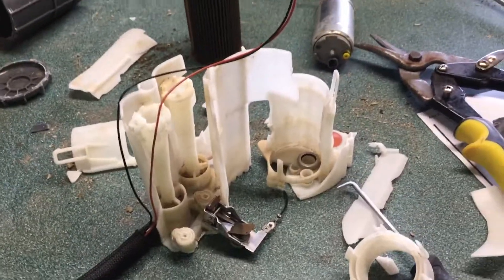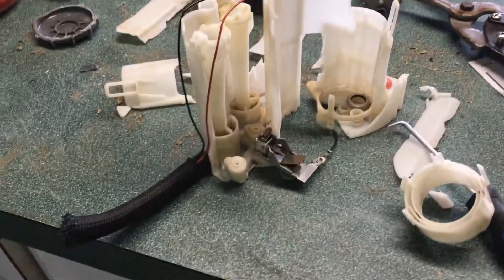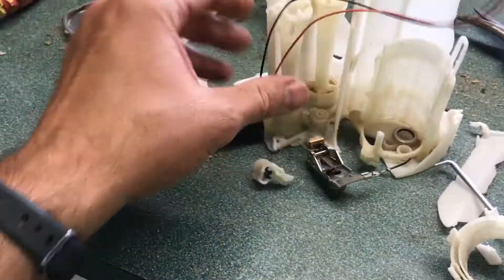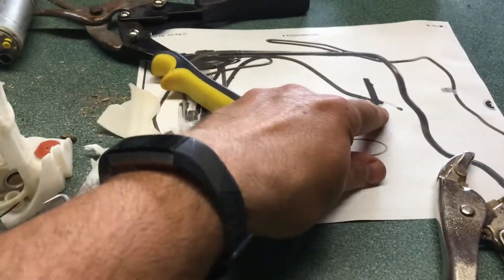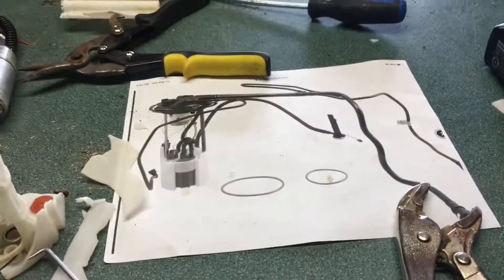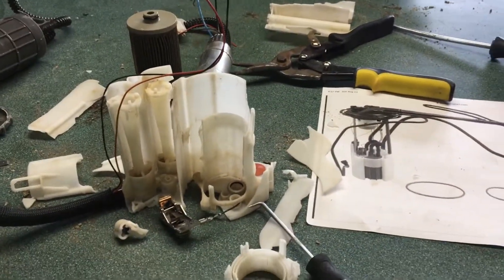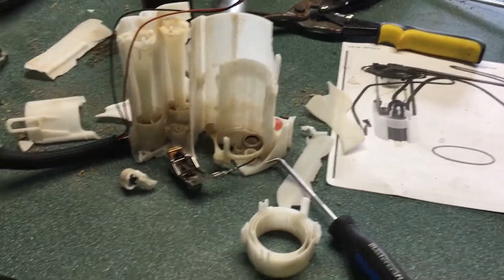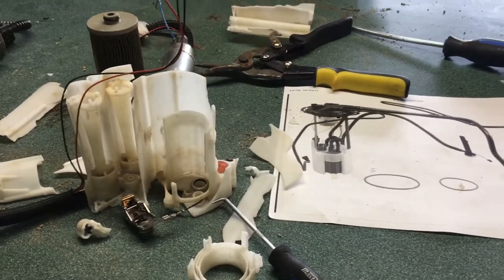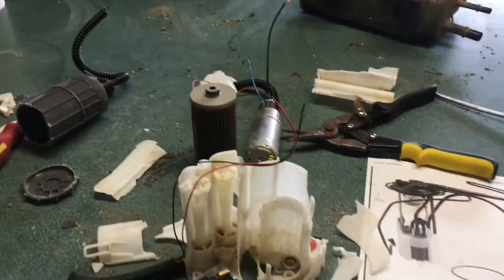That's the synopsis — the quick breakdown of my fuel pump system. There's just one pump, no secondary pump. It's all suction devices: the cup, the filter, and those cool venturis. The flapper valve, all the lines, and the fuel pickup on the other side — it just keeps pulling fuel until one side fills, then runs over to the other side of the tank. If you have any questions on the fuel pump, ask now because this is going to the dump. Subscribe to Turbo 231 for more Equinox videos — next up is a transmission service on the '94 Buick Regal.